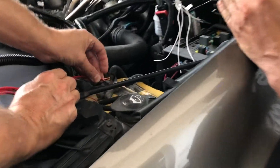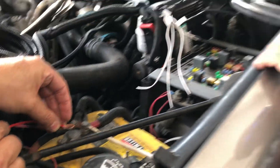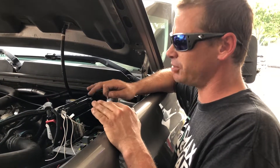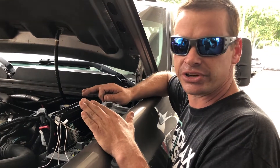This truck has already been run, so the common rail fuel system is completely primed. Generally on a motor that's been sitting for a while, or a motor that you purchased, it's gonna take quite a bit of cranking to prime your common rail fuel system. So it's important that you take the time to do that before you're worried about whether the harness or some other issue is causing a no-start.